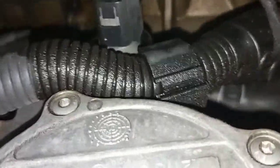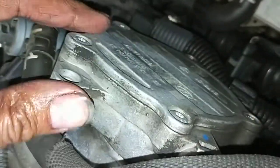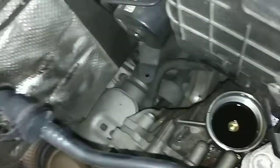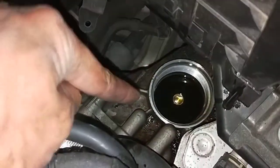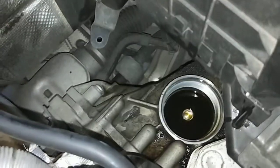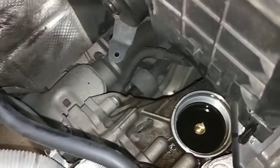What I'm going to do is wash it down using this. This is the part that always leaks on the Volkswagen, on this side here. I also want to show you — I took the filter out on this DSG gearbox on top. What most people usually do is just put the extra filter on and then put the oil filter housing on.